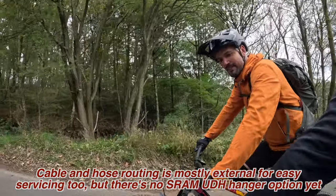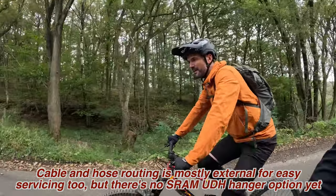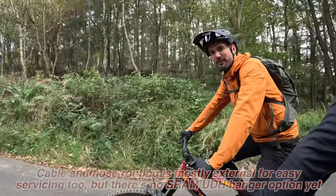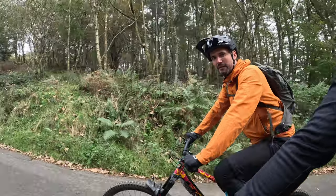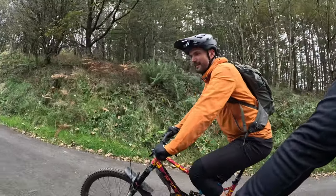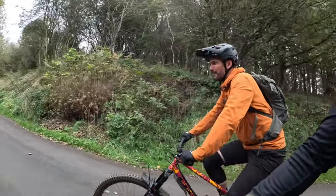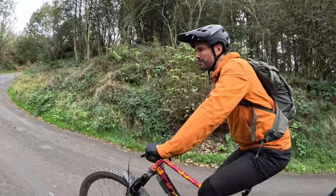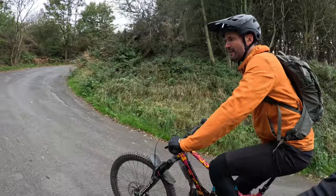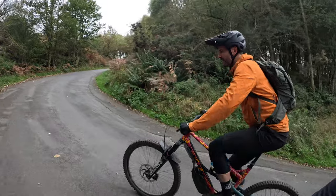Head angle, seat angle on this C3. Head angle 64.5. Seat angle is, where do you want to measure it from? But 76.5. Nominally about 76.5 at your pedaling height, so probably a bit steeper in the metrics that other people use. And then it's half a degree slacker on the C1 and the C2, the smaller sizes, just to make them fit a little bit better,